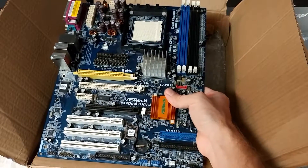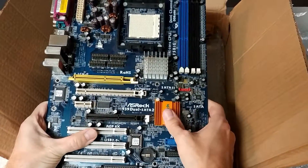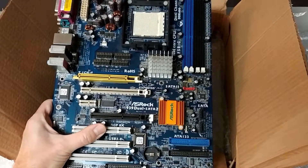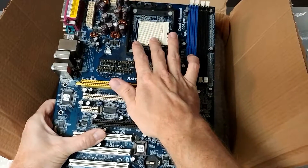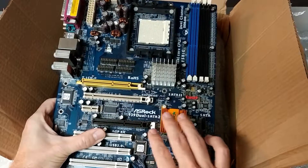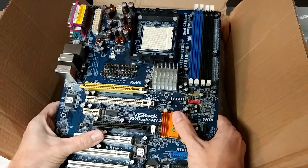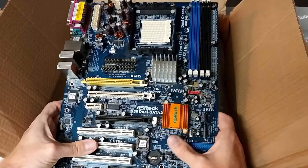This motherboard is really cool and I really wanted to feature a video explaining its features. One thing I did want to mention: this board is a little different from the other ASRock motherboards that had PCI Express and AGP — this actually uses two chipsets, a ULI chipset solution. Basically it's essentially two north bridges. The memory controller is inside the Athlon 64, so that doesn't have anything to do with the north bridges. But PCI Express is connected to this north bridge, and AGP 8X is connected to this chip here.